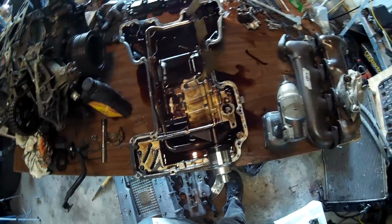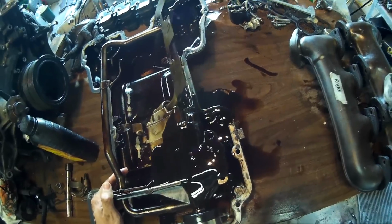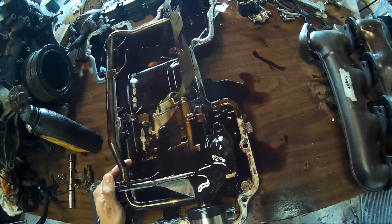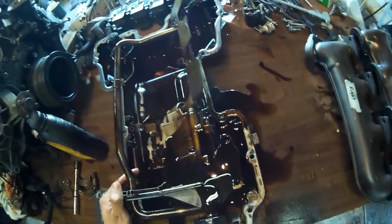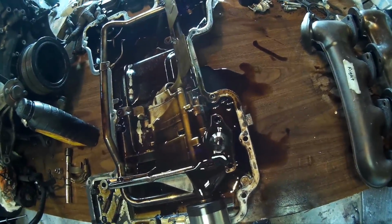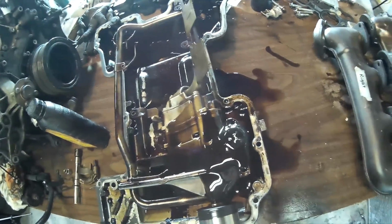So I put that back in the oil pump, closed it back together, and filled some more oil. And this time you can clearly see that there's bubbles coming on the output. That clearly means that this O-ring is already leaking, so there's actually bubbles going into your oil supply. I didn't do this for too long because oil was spinning all over the place, and I knew I had to clean up the mess after, but I'll show you the same thing in slow motion.